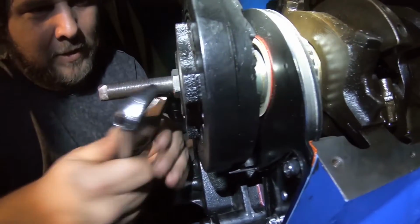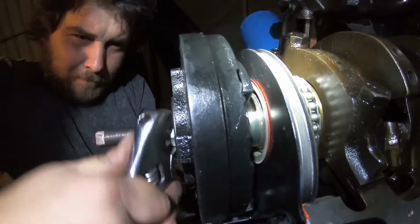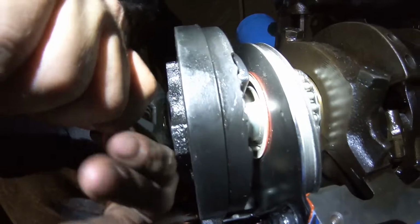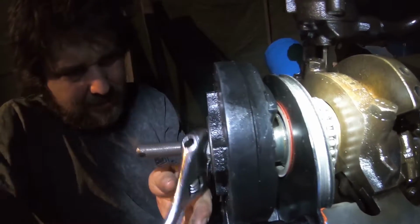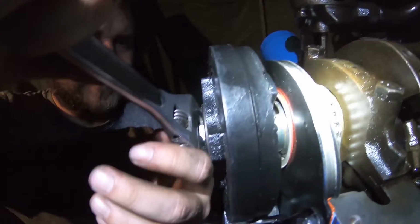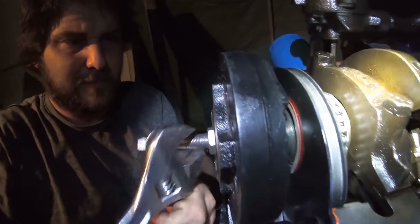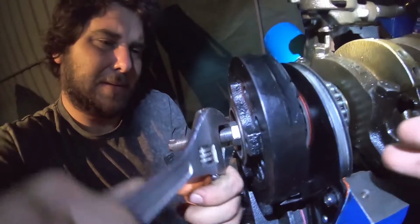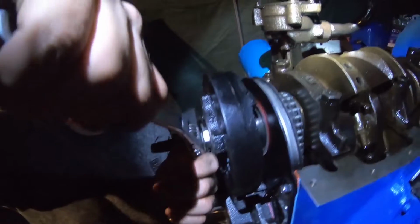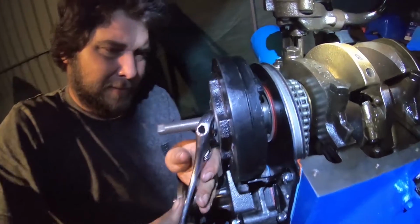I really hope you guys can actually see that line there where the grease is gathering. That's the line you've got to be looking out for. It's kind of my fault. I didn't notice when it started to pick up, but I think it was more on your side where it picked up pretty bad. It was on the bottom where I wasn't looking. Yeah. Well, lucky we didn't go too far. We saved it. If you went too far, you'd completely bust that seal. You have to pull the whole timing plate back off, change the seal. It would be an absolute failure.